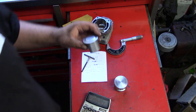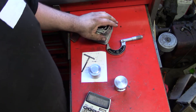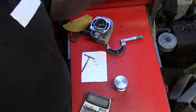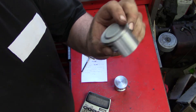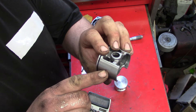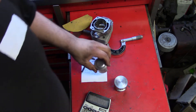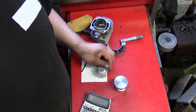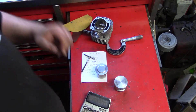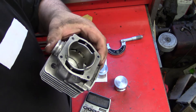The reason why I'm doing this video is because I was having problems with this. This is a 372 from hell. A lot of problems with this piston. It's too tight — it's not machined properly. The skirt here, right here to here, was like flared up. I seen 10 Man and Iron Horse had problems with their saws where they actually had saw failures as a result of the piston being too tight. This didn't blow yet — I saved it just in time.